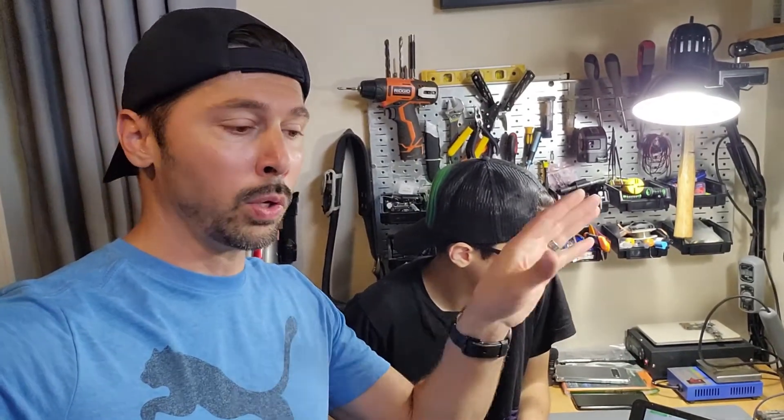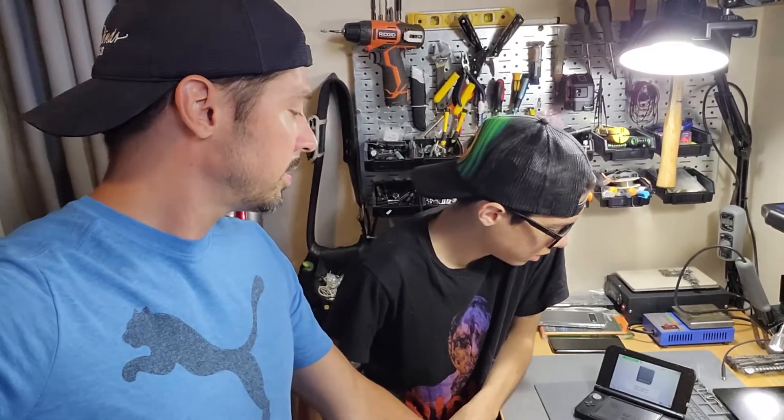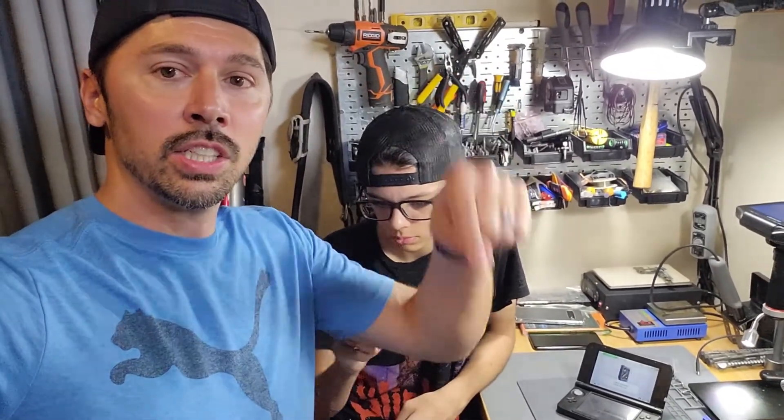So guys, if you have a 3DS XL that has an issue not turning on: if you plug in the power, it could possibly be the camera cable connection — unplug it, try to boot it back up and see if it works. It also had a cartridge issue — just spray some electronic cleaner in there, put the cartridge in a few times, blow out all the debris, make sure it's dry before you turn it back on. So anyway, did you learn anything Devin? No — because I already know how to do that. Then why'd you need my help? Plugging in cables. If you found this video informative, give me a big thumbs up, share it with anyone who has a 3DS XL, subscribe, and hit that bell notification to stay updated on the latest tech videos.